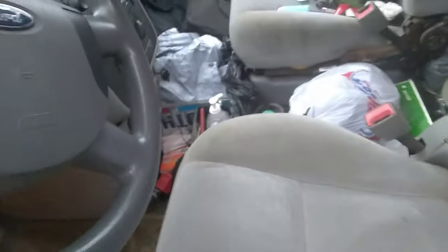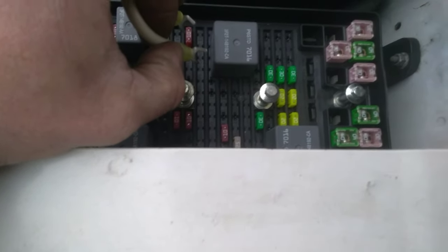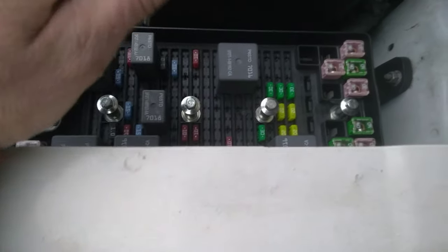I'm going to go ahead and start the vehicle — it's a little loud — and show you what I'm talking about. See, if I was to pull this out, hear how it tried to die just then? That's how you jump that out. Just remember: whenever you're not driving the vehicle and you have it turned off, remove that jumper. If you leave this jumper installed it will run your battery down — that fuel pump will be running all the time. So be sure to remove that jumper. We'll see you next time.